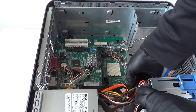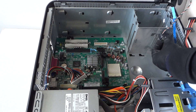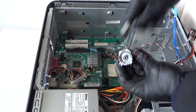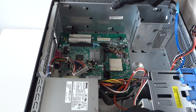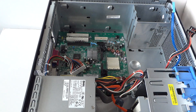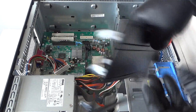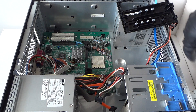There's a four-pin connector here — get that disconnected too. Now disconnect the internal speaker — it has a clip, press your finger and it comes right off. Now disconnect the optical drive's SATA cable and power cable. Press the clip down to release the plastic optical drive bay, then slide the optical drive out.